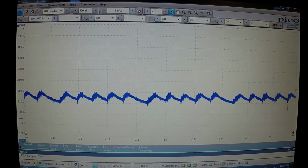Now first off, what I want you to pay attention to is the sound of the engine. You might have heard that kind of da-da-da-da-da, da-da-da-da-da, that rhythmic thing. If you get used to that sound, here I'll do the sound again so you can hear it. You get familiar with that sound, you don't have to do a test. You crank the engine over, you know you have a dead cylinder right there. And so, get used to that.